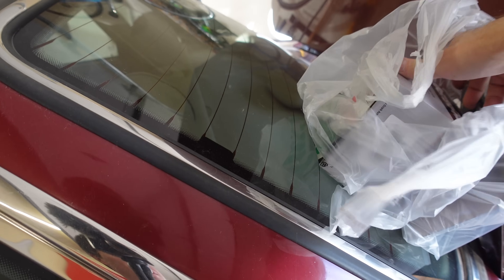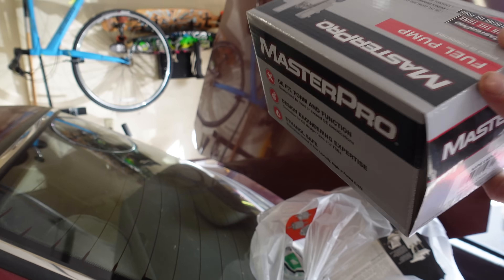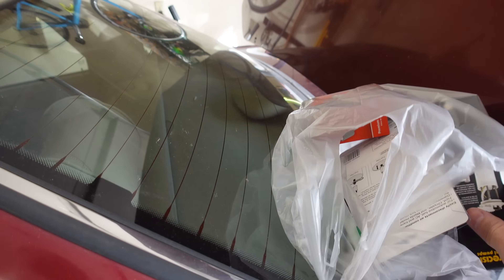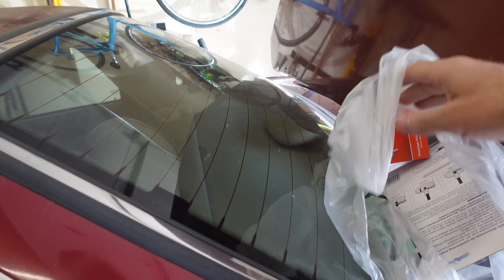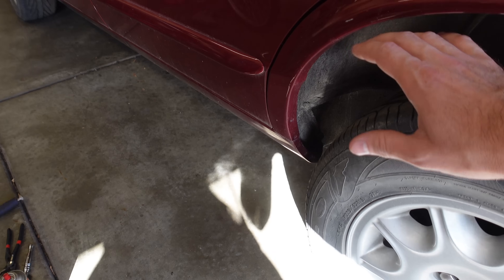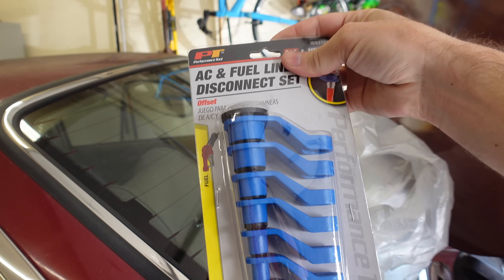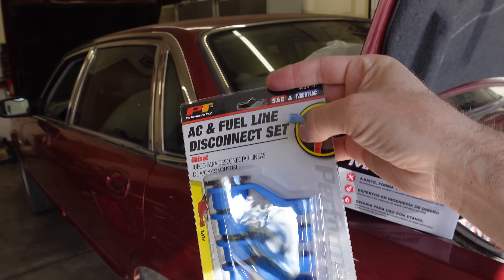Here is our bag of parts. The fuel pump we're going to swap in is the MPE16006 — a universal pump that drops into the bracket with some adapters. We have a new pickup slash strainer because that has to be replaced as well; it's been sitting in nasty old ethanol for years, probably bad. Also a new fuel filter — 33481 — right behind the wheel well. It has flare fittings on both ends you'll need to unscrew; it's not a quick disconnect. I also had to buy another quick disconnect kit since mine is locked away at the shop.